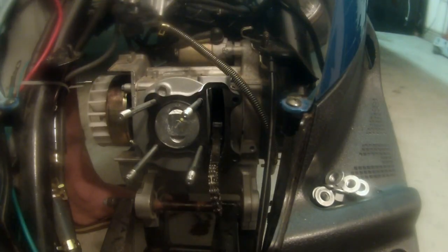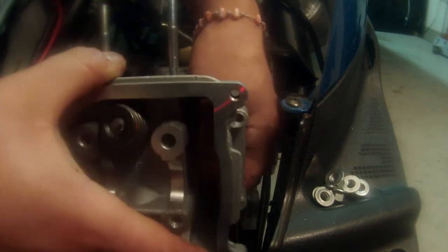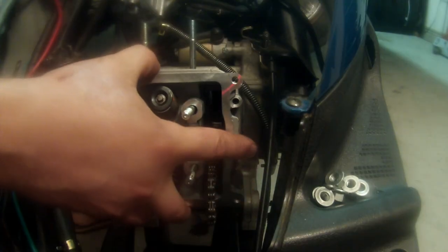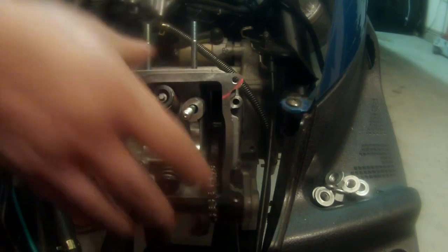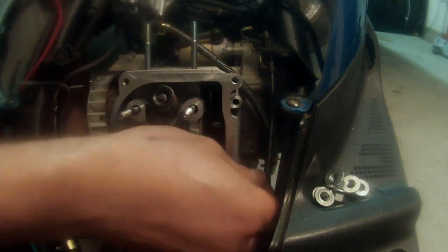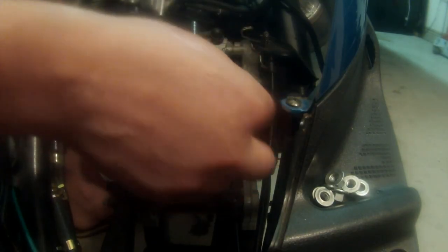Now we're ready to put the head on. We're going to take the big studs that we put on there at the bench — those are going to face upwards. We have our spacers in there. We're going to slide our chain through and work it in, take our time. Make sure that chain doesn't drop down in there. We have our gasket, everything's kosher. We're going to make sure that butts up real good against those spacers, and it does. So at this point, what we can do is take these two long bolts that we pulled out of the side right over here and install those and just snug them down — that's going to hold everything in place.